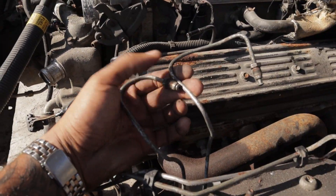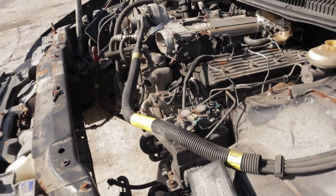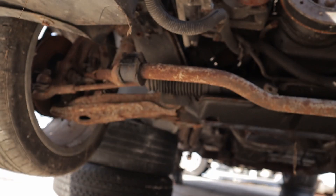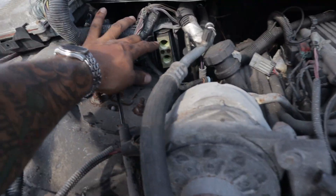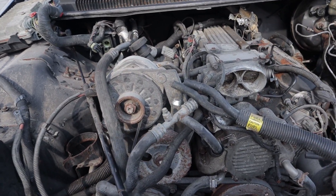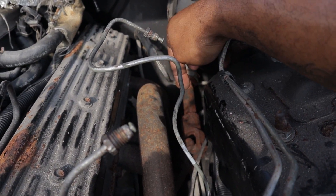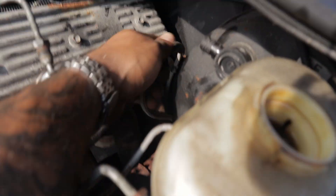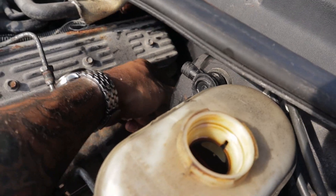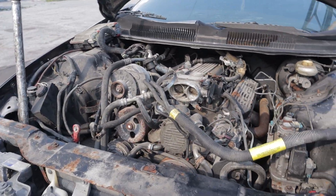I took out the condenser, took out the radiator, removed all the hoses, removed the air box, disconnected the fuel lines, and you're also going to have to remove the two front brake lines because the entire front subframe is going to drop. So you're going to be taking the wheels, the engine, pretty much all the suspension. If you drop down in front you'll see where we had to disconnect the sway bar from the body — one mount there and one mount there. I also disconnected my AC lines right here. The wire harness is going to drop with the engine so you don't have to worry about that. You have to take the bolt out of your steering column so that's going to drop with it — one small bolt right there that holds the linkage together. With my slave cylinder, I completely removed it from the transmission so as I lower the vehicle I'll just sneak it out of the way so I don't have to lose that line.